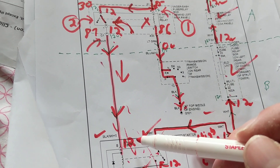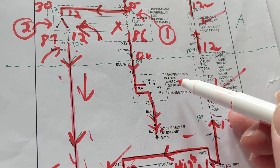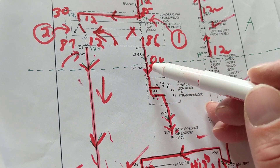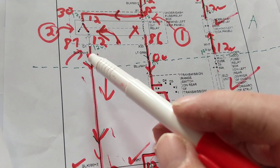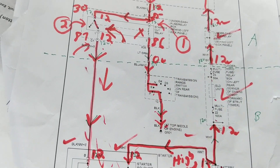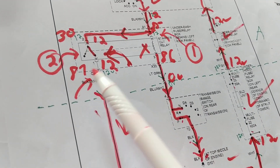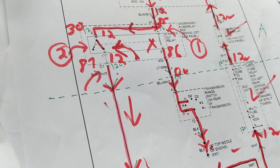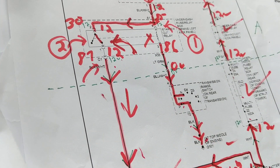If the upstream circuit is confirmed and the starter is still not working, I would need to go directly to the starter. I prefer the voltage measurement method because sometimes you have a computer providing the ground to the transmission range switch or neutral safety switch, and jumping the relay bypasses that logic. If I have 12 volts at the relay output point, I know the computer has activated the relay. I don't really recommend jumping, but since the question was asked, at least try to do it properly. If you found this informative, please subscribe, and check out the other videos on automotive electronic schematics.